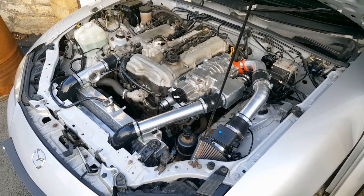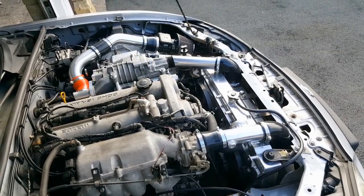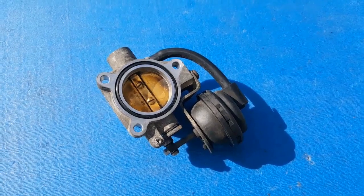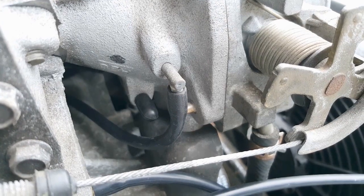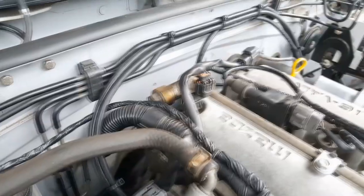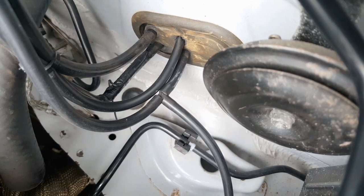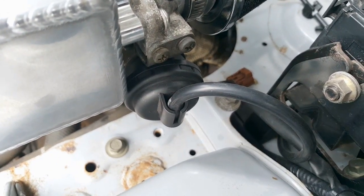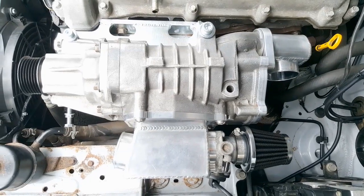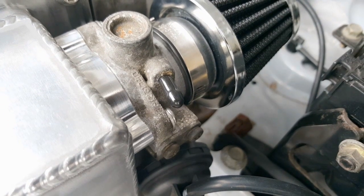The last thing to show is the vacuum line I had to run from the intake to the mini bypass valve to ensure it opens under vacuum. In stock form it takes the reference directly before the valve, which isn't suitable here because of where the throttle body is located. So I've run a 3mm vacuum line all the way from the inlet manifold following the same path as the MAP line, then teed off it — one line going back into the cabin, and the other running to the diaphragm on the bypass valve. When the intake sees vacuum, the bypass opens and allows air to bypass the supercharger rotors. The other outlet is blanked off.